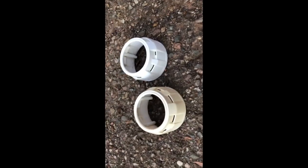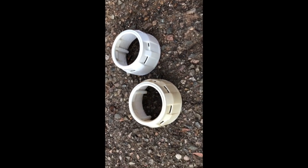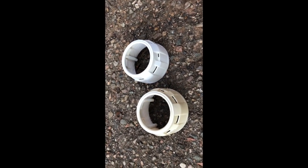See, one's wiped down, you'll see that the Easy-Off made it to bare plastic. Make sure you can wipe it off, use water. I gave it a quick wipe. I'm still going to wash it off, that way any grease and stuff will be off of it for when I spray paint it, but it gives you an idea. We're going to do the same thing to the headlights, which I'll show you.